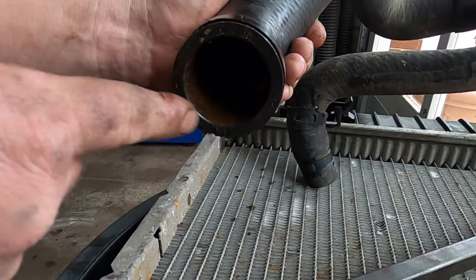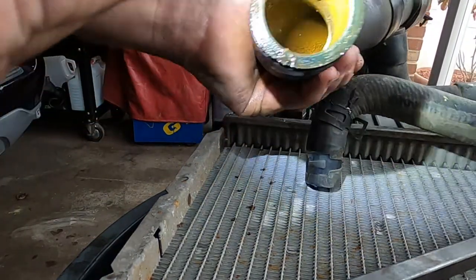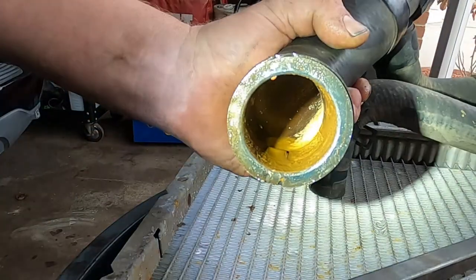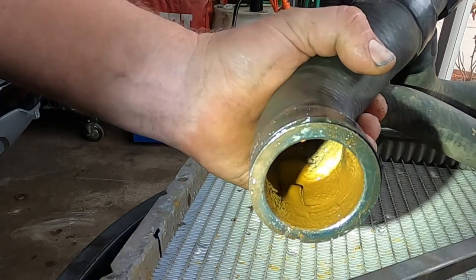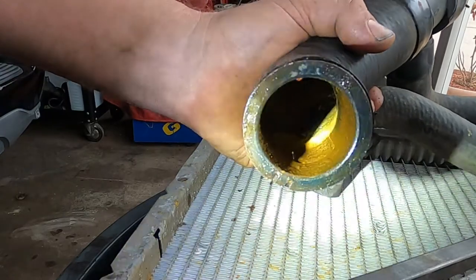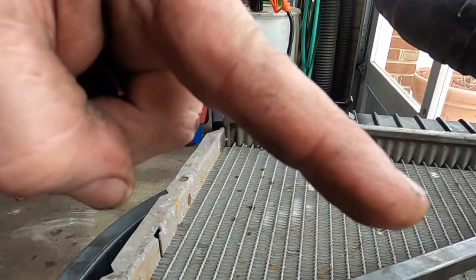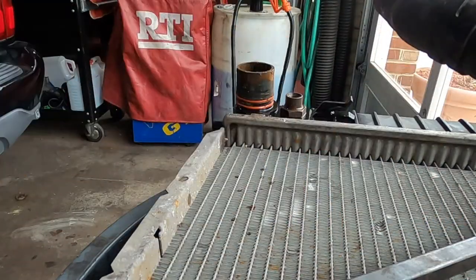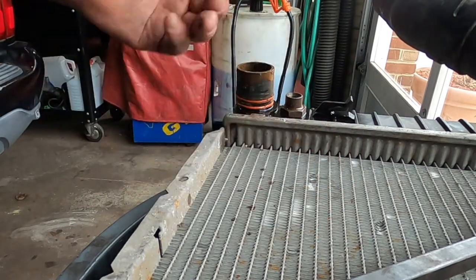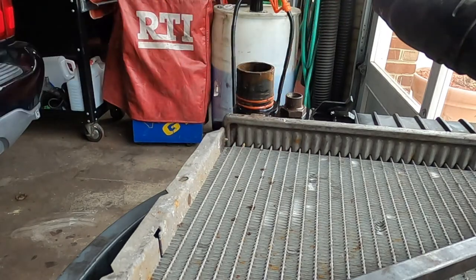That's how you're supposed to do it: bend this tab up and then rotate it 45 degrees, because inside here it's got little catches. If you're doing this job and the hose is as nasty inside as this one — it didn't want to budge — I would replace this hose. Thanks for watching, please subscribe and give me a thumbs up if you like the video. Be sure when you take the radiator out to bend the tab and get a pair of pliers on the metal piece, not just on the hose, to spin it. Good luck everybody!